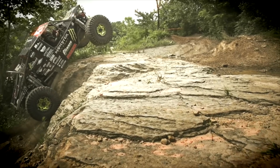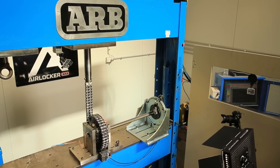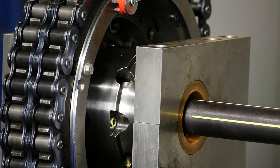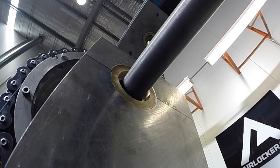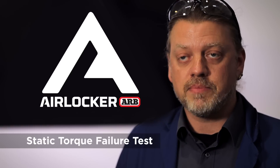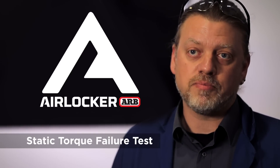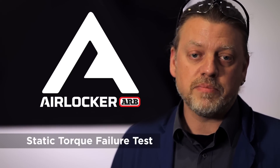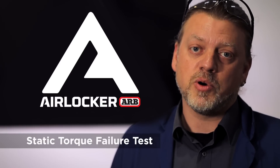It was an industry that was very hard to keep up with, and we saw breakages back then as all motorsport industries see breakages, and we designed and built this purpose-built test rig. It can essentially take the entire rear end of a vehicle and put it under torque loads far in excess of what the vehicle can ever possibly deliver. That allowed us to produce a failure of some component and start picking the best components in terms of axle shafts. We broke a lot of products over several years, varying the design, the heat treat, the materials, surface treatments — basically trialing every what-if in the book that an entire team of engineers could throw at the design, and that's what's given us the motorsport product we have now.